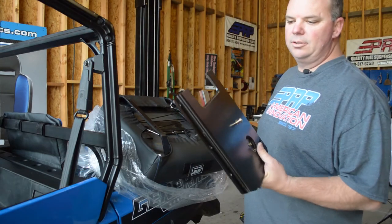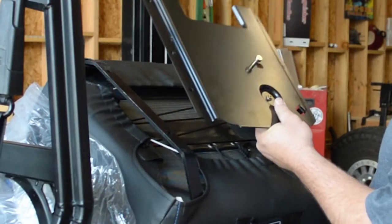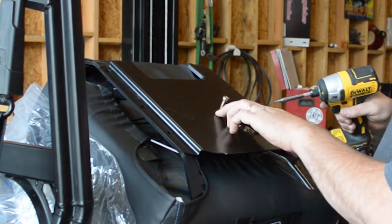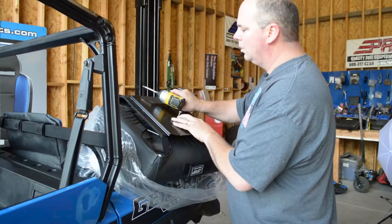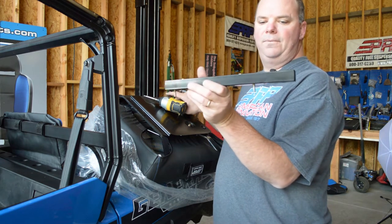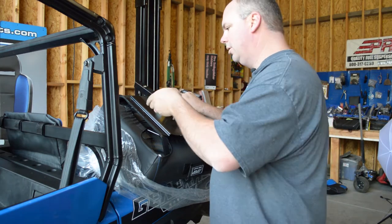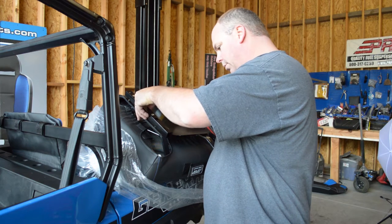Take your seat slider pan and line up the holes. The four holes on the seat slider pan line up with the four holes on the bottom of the seat. Make sure the handle is coming towards the front and the little bolt is facing you. Then take the tubes, drop in the bolts that don't have the spacers and washers on them — it makes it a lot easier to line up those bolts with the holes.